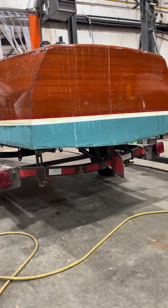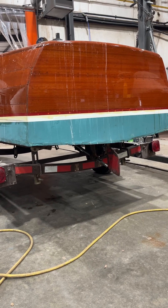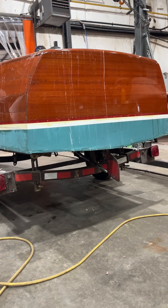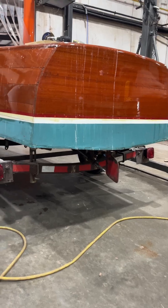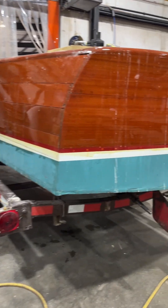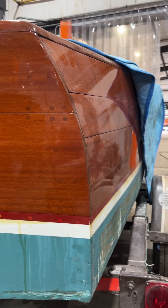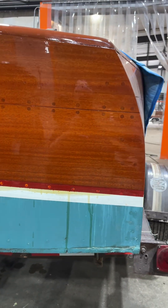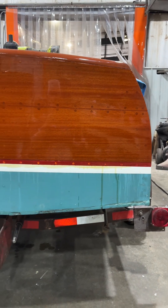This will be fine. A couple of questions — regarding the location of the vent: sometimes the fuel tank vents are on the side planks, but there isn't any on any side planks. So I'm assuming it was in the transom, and that makes me assume the transom planks were changed, and we want to get it back in the right spot.